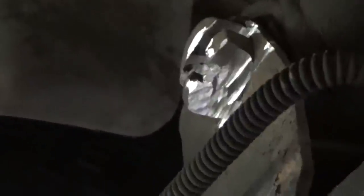So I'm going to go up and down, or vertical, it should be said, take off that wing and that wing right there and see if that'll help me get the top part of that bolt head off. I just wanted to pause for a moment to show you guys how I was cutting that. In this case I was throwing my sparks over to the drum, the rotation of the head, because it's not going to hurt anything there. You just may have to clean the dust off.